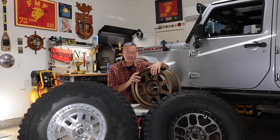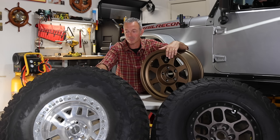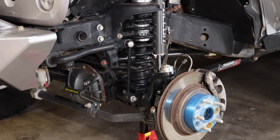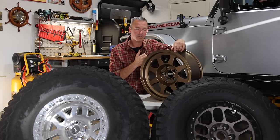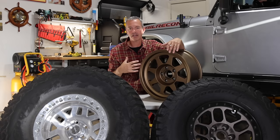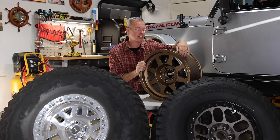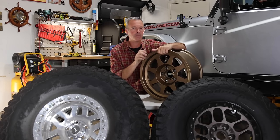Weight is so important when talking about your wheel and tire combination. This 39-inch tire with the KMC wheel is a heavy beast — I would not put it on my wife's Jeep because it would wear out components and could bend or break an axle, but the JK is built to handle it. Also consider the weight rating of the wheels. For Jeeps and smaller off-road vehicles it's not as critical, but most wheels are rated anywhere from 2,500 to 3,500 pounds. If you're putting these on a full-size truck or a big massive overland vehicle, you definitely need to pay attention to that — don't put a lightweight wheel on a heavyweight vehicle you're going to build out.